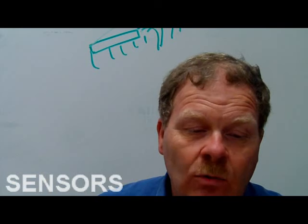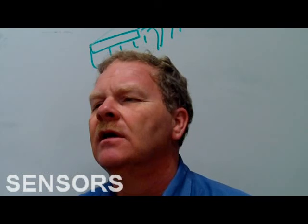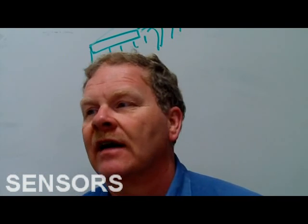Number 9, OBD1 technology can diagnose and detect only system failures and system degradation. That's false. They've got rationality checks and all kinds of stuff they do. Like your OBD1 systems, as they got a little more sophisticated, would know if it was telling the idle air control to open and it didn't see the mass airflow reflect there was more air coming in, it would throw you a code for that. You know, a 5 series code or something. So yeah, that's false.